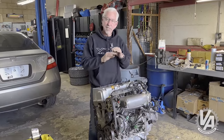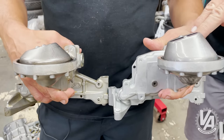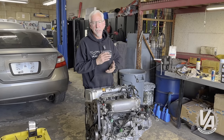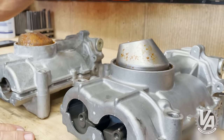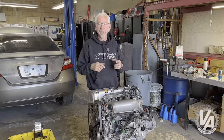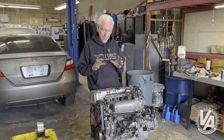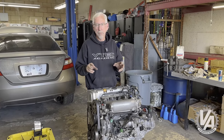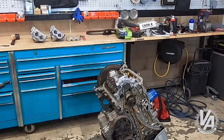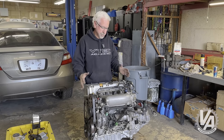That rear bottom engine mount bracket is only on the 06 SI oil pan, so that means we had to change the oil pan. If you're changing the oil pan, it's actually deeper, so that means you need to change the oil pump as well. The problem is the oil pump that comes on the K24A2 isn't deep enough. You have two choices: you can use your 06 Civic SI oil pump — buy the oil pan and oil pump together — but you need to cut some windows in the top of the oil pump housing to clear the crankshaft, because the counterbalance shafts will contact the stock SI oil pump. What we decided to do is get an FD2 oil pump from an 08 Type R from Japan. That required a new chain for a K20, plus a tensioner and a chain guide. We installed all of those on this engine, put the oil pan on, and then our engine was basically ready to go.